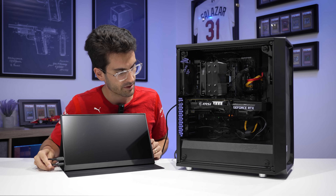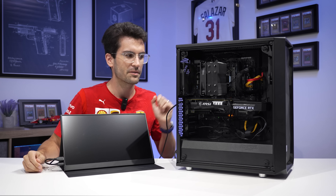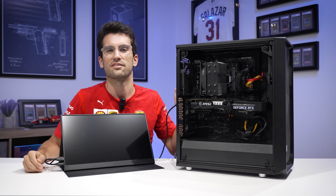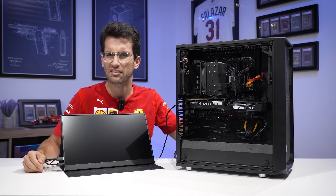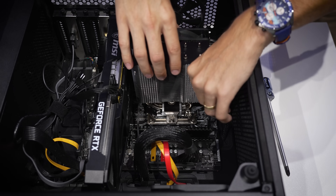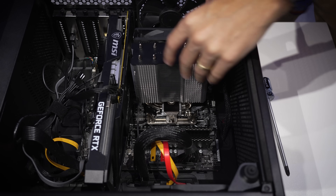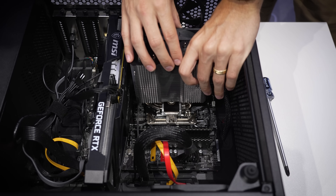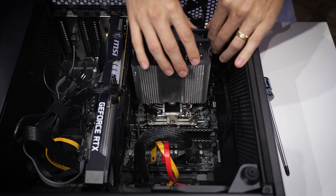I'm going to do something I don't normally do to start off a video like this: I'm going to look directly at the socket. I want to look at the CPU because I know that's where things were messed with. According to the owner, everything was working perfectly fine before he touched it. Usually at this point we'd clear the CMOS, but I'm fairly confident we've got an issue with the cooler area. It doesn't make sense why it would be anything else if the only thing messed with was in this area.